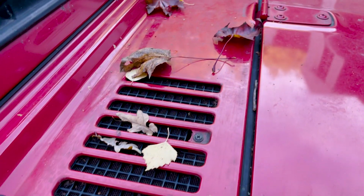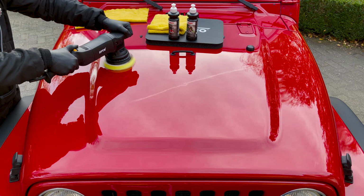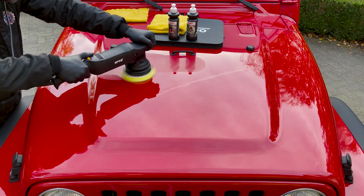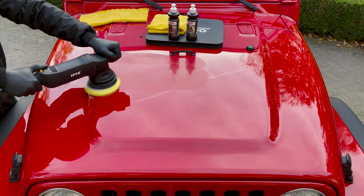Secondly, and maybe the most practical reason you should remove them, is that when you polish your car paint or use a power tool to wax your car, some of these contaminants will come loose and get caught in your polishing pad. Because these minute particles are sharp and hard, they will mess up your car paint, leaving swirls and scratches. Guess that's not the intended outcome.